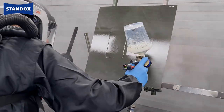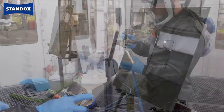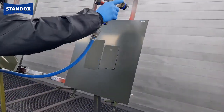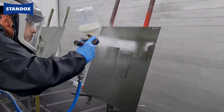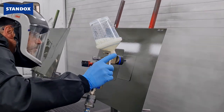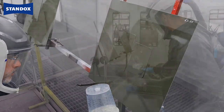To be efficient it makes sense to apply not only the default mixture of the suggested matte level group but also samples either side to cover these possible variables. Label these spray outs for future use as they will help reduce process steps if faced with a car in the same colour that may not have the same level of gloss as this one.